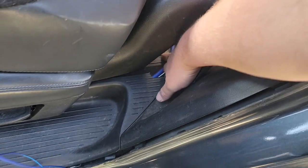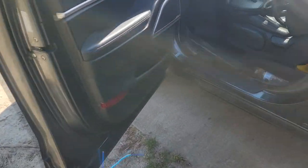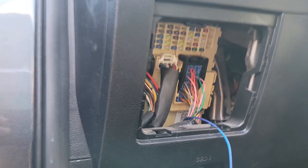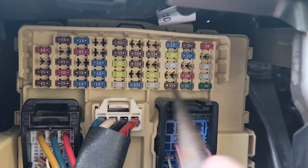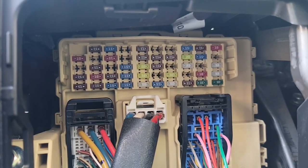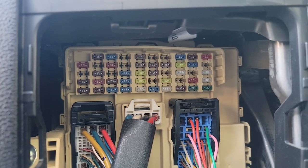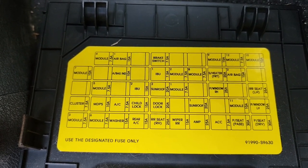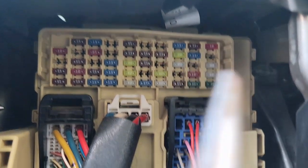I messed up — I was actually supposed to run the remote wire on this side while I was running everything, so I've got to pull it all back up and run the remote. The fuse for the remote is right under the steering column. I'm going to use a 7.5 amp fuse — it's the third one from the right on the bottom row. That's the accessories fuse, so that amp is not active unless the entire dash cluster is on, with all the accessories for the radio and everything. The radio is under that 7.5 amp fuse. I'm going to pull it out, wire it in, tap into it, and get to the back.